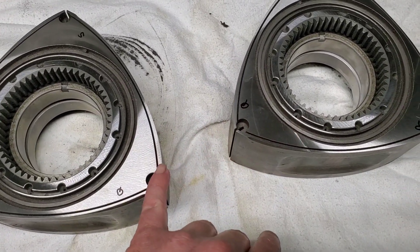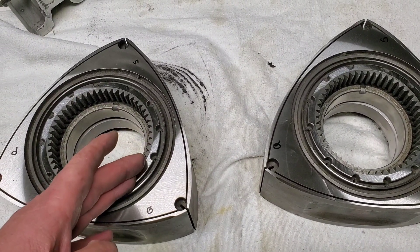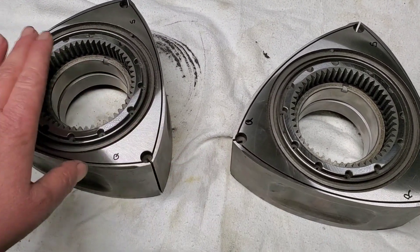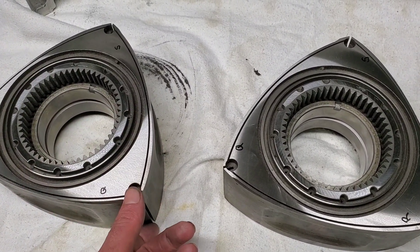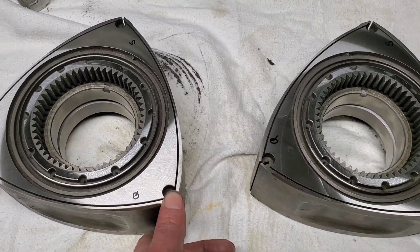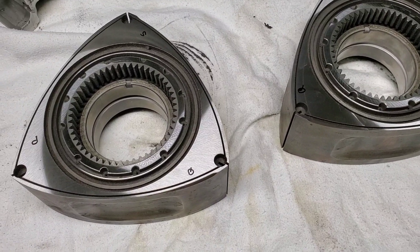Just so people know, you don't want to shave the rotor flat. There's actually a distinct land or gear height and then tip height, so it's not just about cutting them down — it's about keeping your proper step values and narrowing the overall dimension of the rotor very specifically. We do a grinding process; some shops do a lathe process, but we're actually doing an upright mill grinding process.